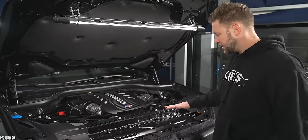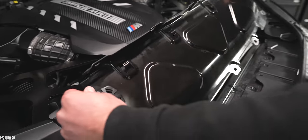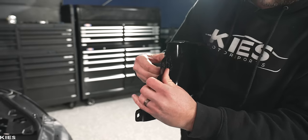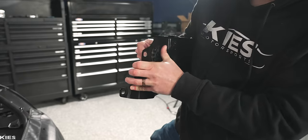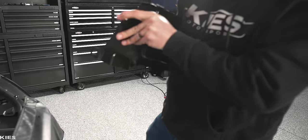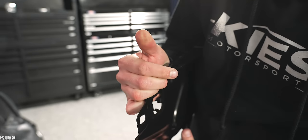Once you've done that, you can carefully remove this piece here — just be mindful that it is tucked under here. What I would recommend doing is pull it up and slide it out like so. You are going to need to take these little plastic clips out — this is what basically holds your radiator in place. BMW puts four clips on here, so it works best if you do it with four hands. All you really need to do is just press in all of these clips. Start on one side, do one and then another, and then you can just get the rest out.